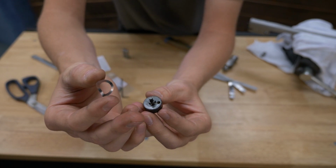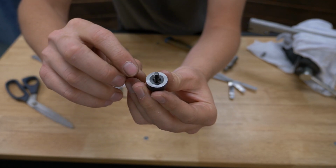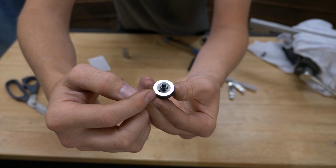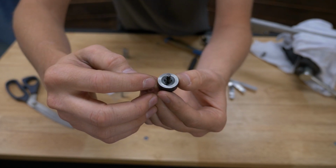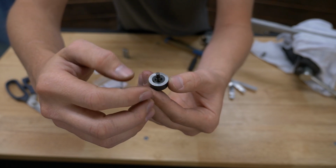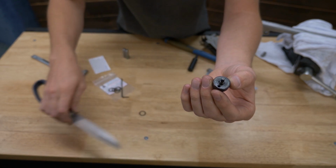So these bushings are completely round, essentially flat washers. And so it actually blocks off the threads that hold this bushing to the frame. So when you install these, you're gonna have to cut a small little pizza wedge out of this thing, and a pair of medium duty scissors will do that.